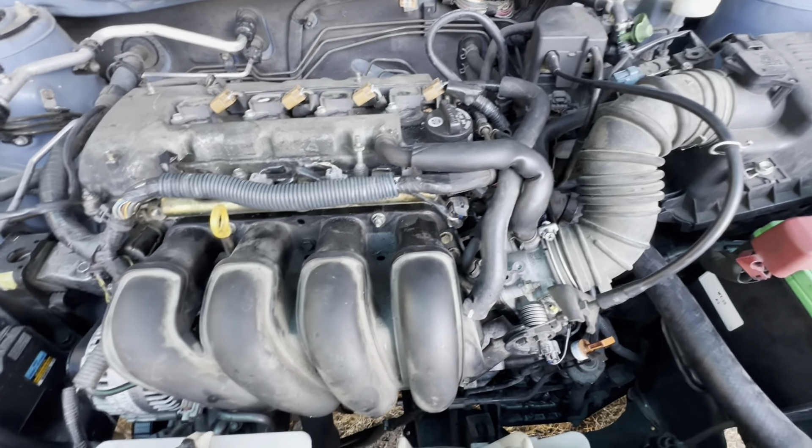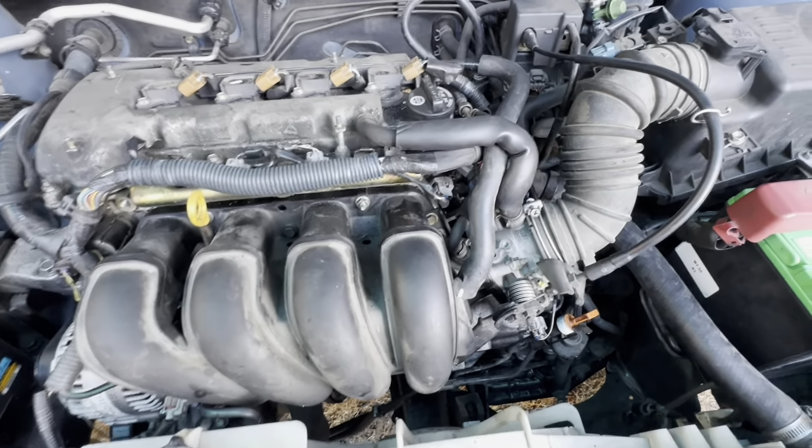That's pretty much all I needed — the plastic manifold, coupler, single fuel rail line, along with the PCV hose. Had to get a little creative there. Other than that, you can reuse everything. I'm going to do my best to get these stickers off, or I'll take pictures and have my sister clean them up on Photoshop to get replicas. Took a while to start because I had to prime the fuel pump a couple of times after disconnecting the fuel rail, but it's idling fine for a cold start. Let me check for any fuel leaks.